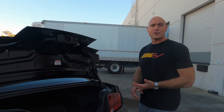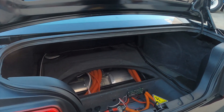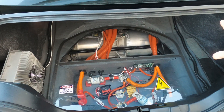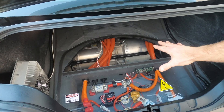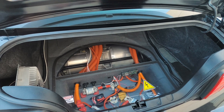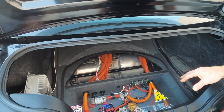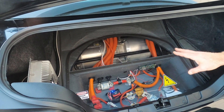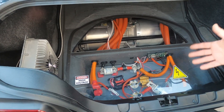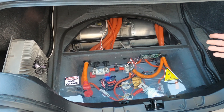The batteries are that way too — they make great energy-dense batteries. It drops current kind of quick, but it also has to get you 300 miles and last at least a hundred thousand miles, so Tesla does a great job of engineering. Anytime you see these big orange cables, this is all your high-voltage cabling. They actually have a dedicated Pantone color for EV orange. In here you've got your contactors — giant relays that connect and decouple your high-voltage system. The PDU is controlling the state of all of these various contactors.